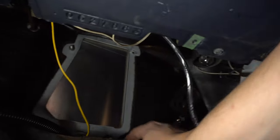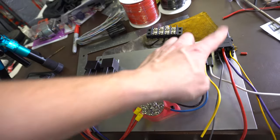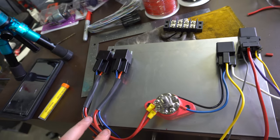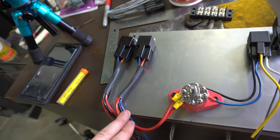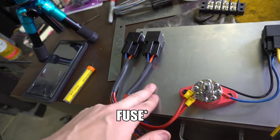The plate just goes up in there and hangs on that bolt, then has the other mount over here — so the plate will be hanging right here. The main power wire I ran in earlier is right here, it'll come up and hook onto that lug. All my relays are here, so if I need to get in and work on anything I can just undo two bolts, drop it down, work on it, and put it back. I only have one more connection to make — but then I realized I don't have any fuses. It sounds like fuses should go in-line here, between the power and the relay, so if it pops it'll pop there.